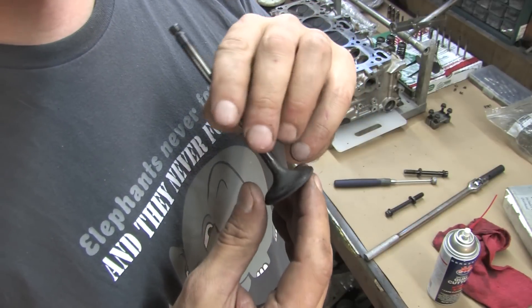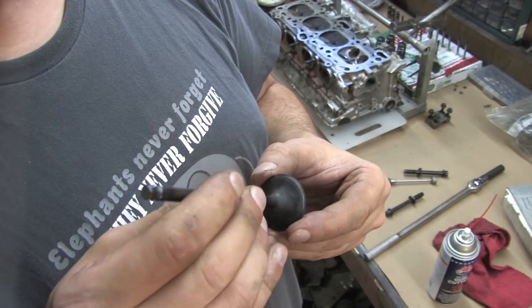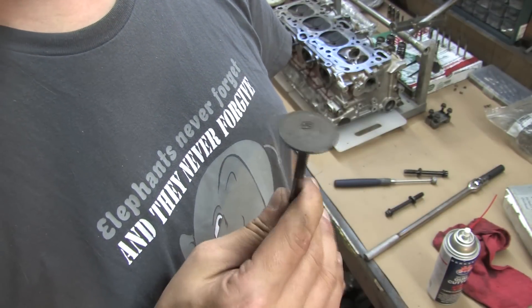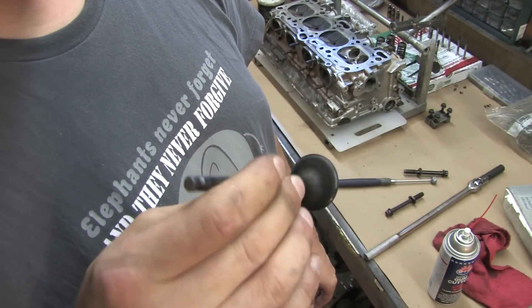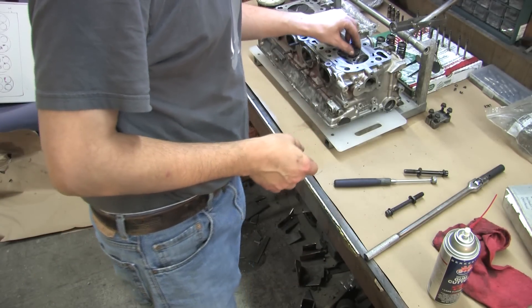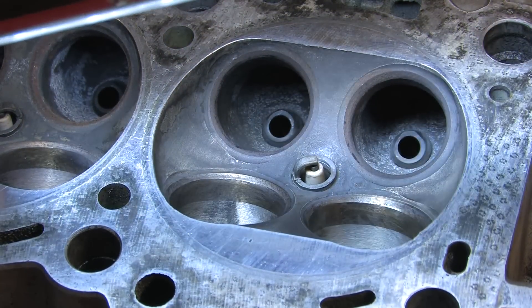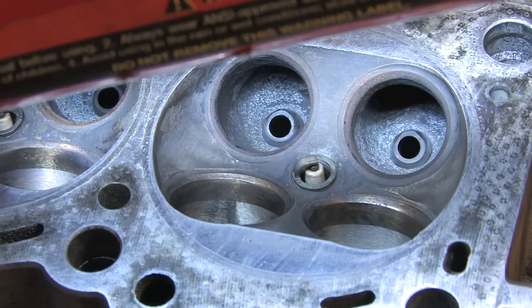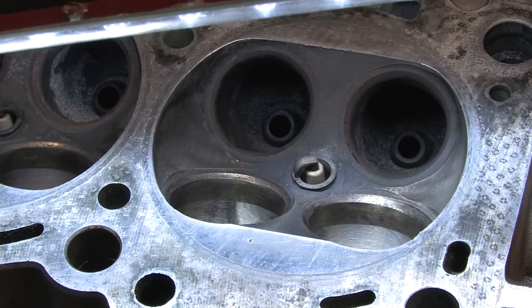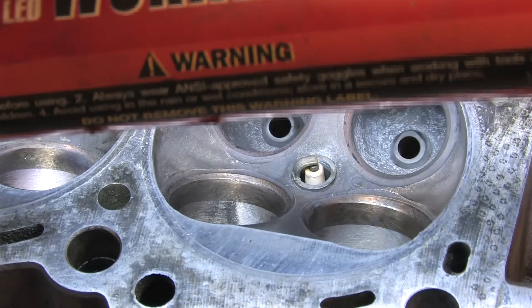These look great — there's absolutely nothing wrong with these. The valve seat is in perfect condition. It came clean with liquid cleaners. They could look better if I spent some time on it, but I don't need to touch these. Let's get a second look at that other head. The valve contact areas are so pitted I can't even see them. I think it's time to go with new seats. Some of the intake valves aren't so bad, but the exhaust ones are just toast.